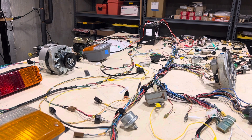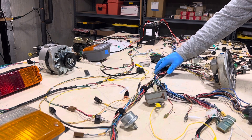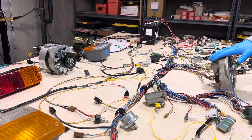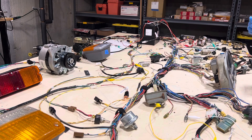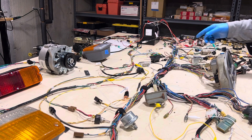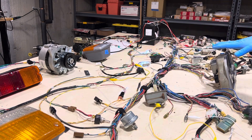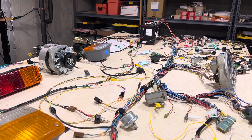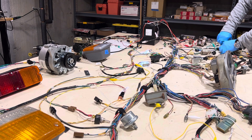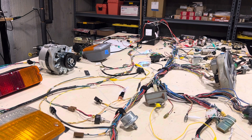You'll notice a few lights. The lights that are blinking — this here is your fuel sender, giving out seven volts controlled by a regulator in your cluster. The same thing over here is seven volts and that is for your temperature sender. This steady-on light is your oil pressure, and that is controlled by your cluster as well. When you turn it to the start position, you'll see another light go on, and that is your starter.